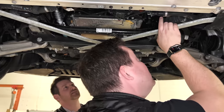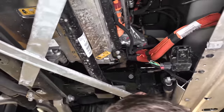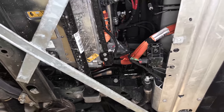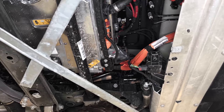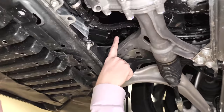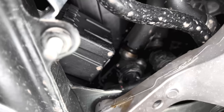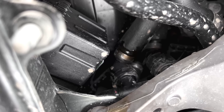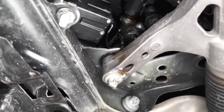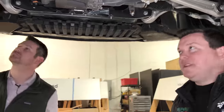There's a big composite motor mount right there — that's supporting the overall assembly. Up here in the front there's another pedestrian alarm, but you can see here there's a band clamp with a coolant line that's leaking. I don't know how many miles are on this car, but it is most certainly emanating from that joint — noticeable, though not a Class 3 leak.